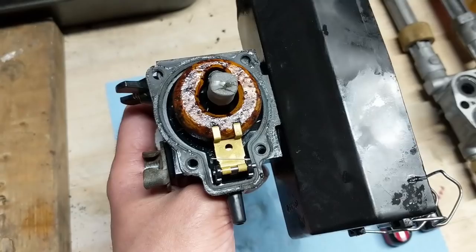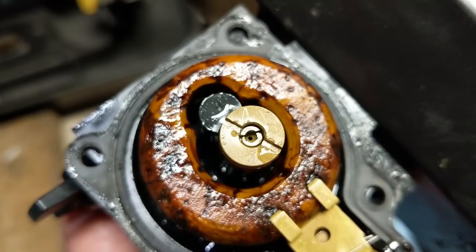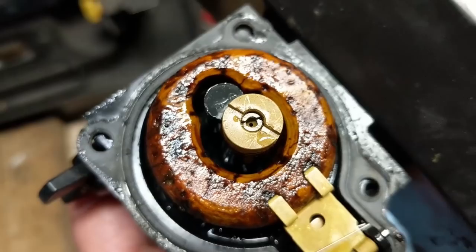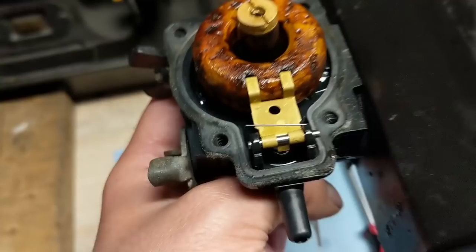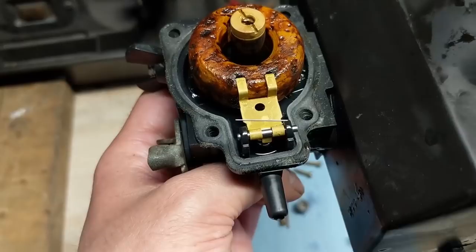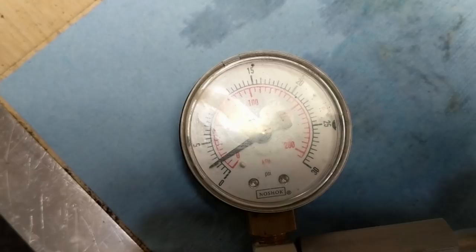With that gunk buildup, the machine is going to be fighting for fuel. I'm going to pull off that screen for a better look at the main jet — it looks free and clear of debris, but I'll remove it anyway. The center jet is the main jet and the outer one is the distribution tube that goes all the way down into the center of the carburetor. I can then pull the pin and remove the float and needle valve. First I want to pressure test the needle valve — and we can see right here that it is not holding pressure. That's a slow leak on the needle valve.